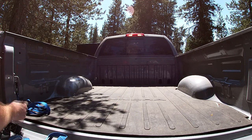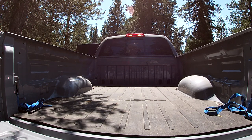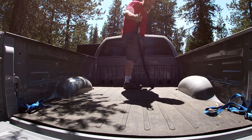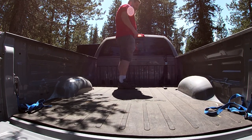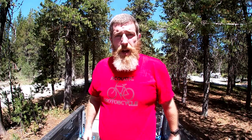I like to do everything as smoothly as possible, so I like to prepare everything as much as possible. That means putting the straps on and setting them up there where I can grab them as soon as I put the bike in. Because I'm by myself, either I've got to put it down on the kickstand, or it's a lot nicer to just be able to wheel it in, grab the straps, and hook them on. I'll position the straps to the right and left of where the bike is going to be, so I can just grab them while holding the bike. It's important to get these out of the way so you don't get one stuck under your tire. Better to have more slack than not enough - it's really hard to hold the bike and reach down, pull on the strap, and hit the cam buckle to release the slack.